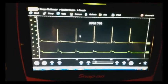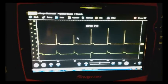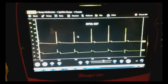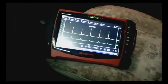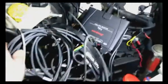I'm going to use the longer USB cable so I can put the unit in the vehicle and just run the USB cable into the cab. The scope is set up for a road test now, running the USB cable in. This nice detachable scope module allows me to leave everything under the hood and only run the USB cable out underneath. I've secured all the wires up so they're not going to touch anything or go into the fan blade.